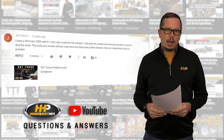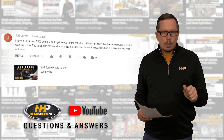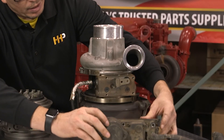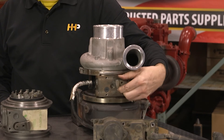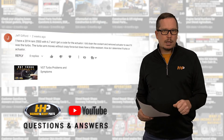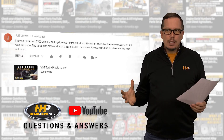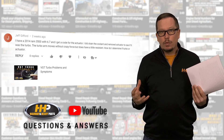The next step is the turbocharger. When you say it moves without crazy force, we know that turbocharger has a certain range that the sector gear needs to move, and it has to move fairly freely — without binding or sticking from stop to stop. That's going to be determined by how freely the vanes move through the shroud plate.